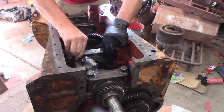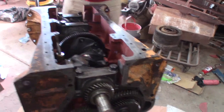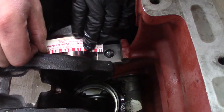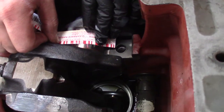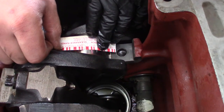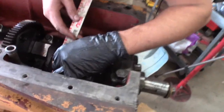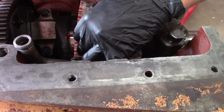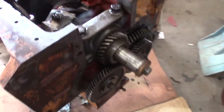I gave it a rock with the bolts because they're snug in there. Once they get set down in there, put as much upward force on it as you can. Okay, that looks like three to me — get the scale out. There's the four, there's the three, and once again it's between three and four. The tighter tolerance actually makes the plastigauge wider — that's how the principle works. It's closer to four on that side, but that's well within range. We're good.